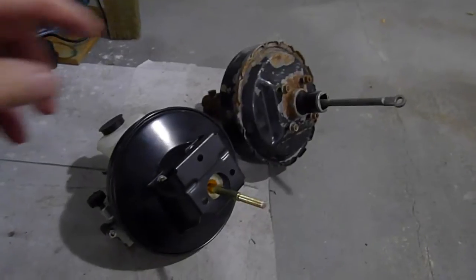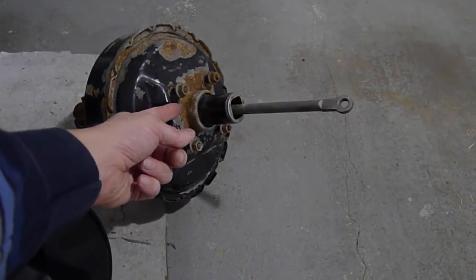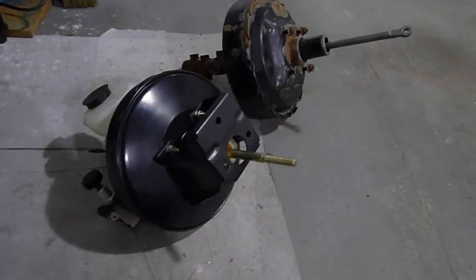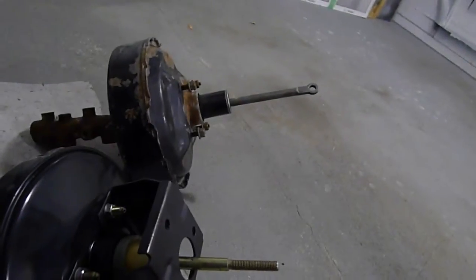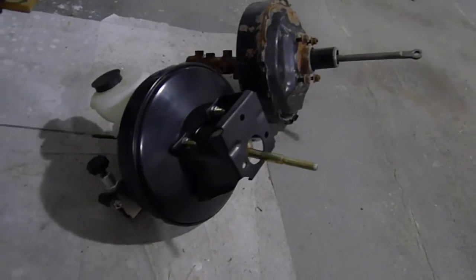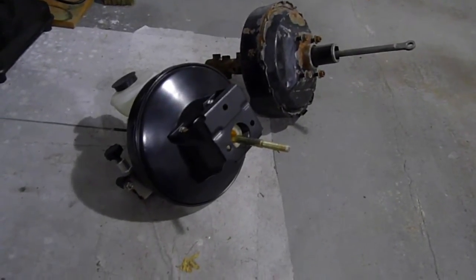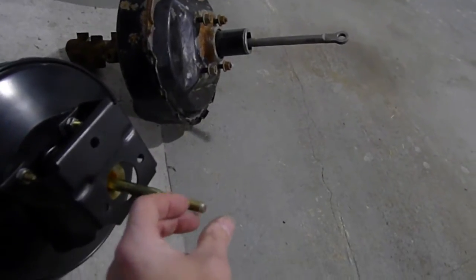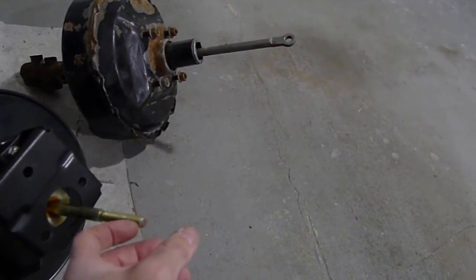This is the US Rabbit GTI servo for the brakes, and it's 8½ inches long from this face where it mounts to the bracket to the end. The Mark II — which I need because I switched to the 22-millimeter piston master cylinder — wouldn't fit the original. So I've gone to the Mark II master cylinder from an '89 Cabriolet, because the Cabriolet used Mark II parts as the Mark I design was overlaid with the Mark II. This unit is shorter and threaded, so you'd have an adjustable clevis pin for the brake pedal — about an inch and a half shorter because it needs the clevis attached.